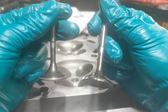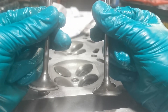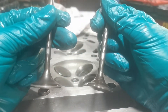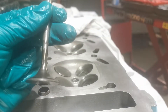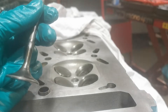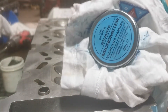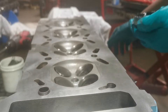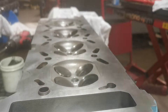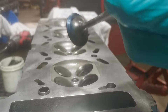So what you need to do now is clean it up, and if you have got yourself some engineer's blue, rub it around the surface and that will just highlight to you all the high spots and low spots. You can notice the difference between this valve stem where I've bedded it in and this one here which I haven't - see the nice gray line all the way around it. So that should be seating properly. I'm going to clean this up and put some engineer's blue around it just to verify the surface. Good luck trying to get the lid off this tube because it's really hard - three weeks later I finally got the lid off! You don't need much of this, literally just a fingertip-full.